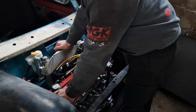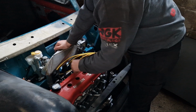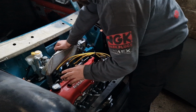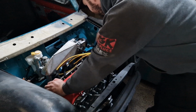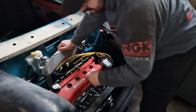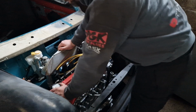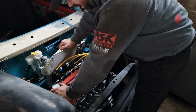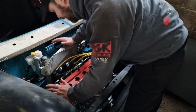It's not the oil that's staying, but it's oil that's in the engine now. Because I was worried that there wasn't much oil in it, since I've taken it out of the Micra and put it in here, I've put oil in it. It's got more than it needs for now. And I've turned it over by hand, and it does turn over, so that's good news. So that's the engine side of things. Since I've done that though, I've noticed I've got a leak, so I fitted a new sump to this engine, because it had been parked in a field for a long time and it was rotten underneath. So I fitted a brand new sump, and it's leaking because I fitted new, because we all know I'm a bog pervert, we're all aware of this fact.